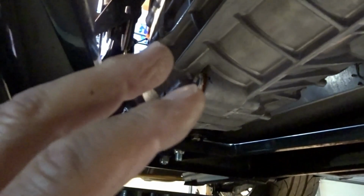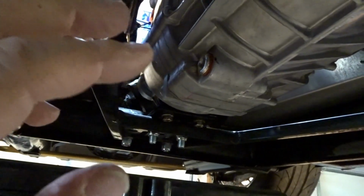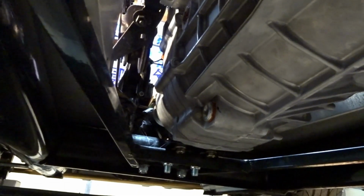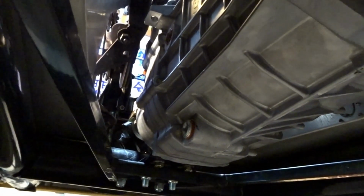Alright, here's an easy way to fill your transmission, and it doesn't matter if it's a Tremec or the old Borg-Warner T5. What you're going to do is pull the fill plug out, position your drip pan below where it's going to dribble out of there. And then you're going to go up on the top. You're going to pull the shifter out. In this case, we're actually going to pull the inspection plate off the center of this TKX. We're actually going to fill from up there.